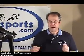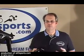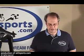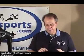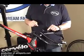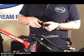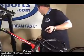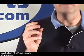All right, next on this bike, we're going to install the armrest. Now, depending on what kind of aerobars you get, or if it's even a tri-bike, it might be a road bike, some of this is certainly going to vary. But for the Vision TT bars, these are the armrests that come with them, and they need to be mounted like so, with the back portion actually being the elongated section. So keep that in mind. Now, you'll probably get two sets of risers with these. We like to send both the 12.5 as well as the 25mm riser sets. We always advise to use the 25mm riser, as this is probably the best height for most folks.